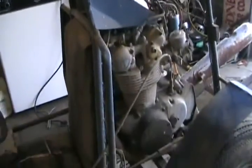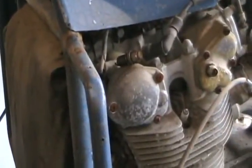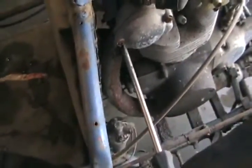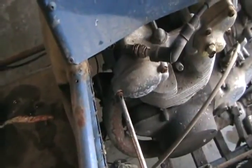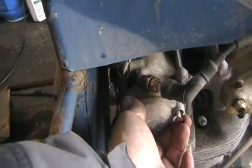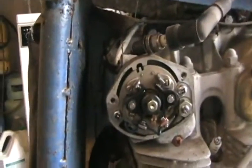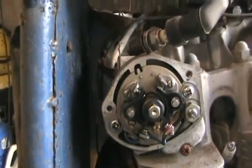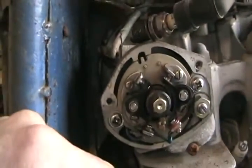Got the side cover off. Now you can see the old motor. Got that little cover off — it comes out no problem. Got to love your Hondas. There they are — old-fashioned points and condenser system. Now I've just got to sand there and there and check the gap.